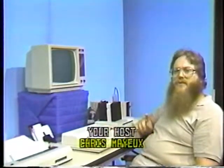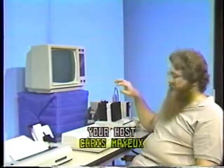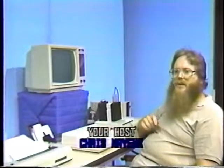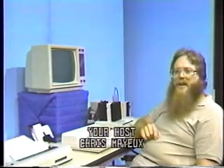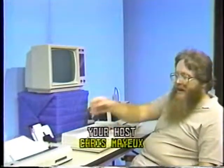First of all, I strongly suggest the recommended use of some kind of an RS-232 serial cartridge for use with a modem. The internal RS-232 port on the color computer is a complicated thing to use, much less explain how to use. So, most serious color computer users reserve the internal RS-232 port for use with the line printer. If you haven't already done so, switch on the power on your modem and your line printer.